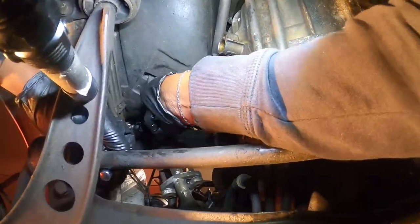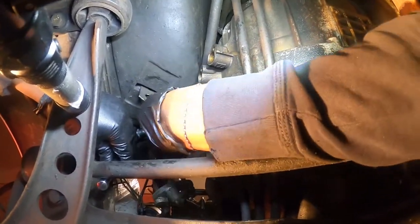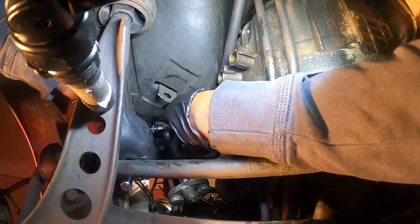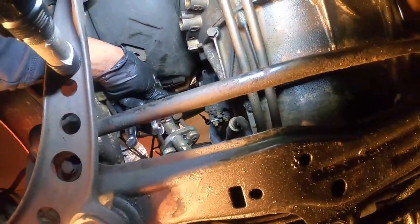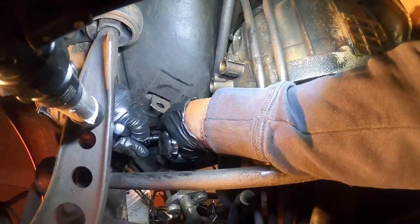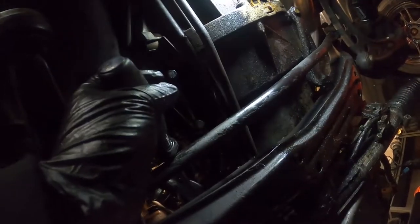Next is mostly a preference thing — if you want to remove the lines from the bottom of the steering rack, now is a good time. I went ahead and detached the top and bottom 13mm bolts attaching the steering knuckle to the top of the steering column and to the steering rack to basically release it. Once you get these out it's still not going to drop down easily — I had to use a flathead screwdriver and a mallet to separate the clamps holding it to the steering column, and that's what got it loose so it would drop out of the car.